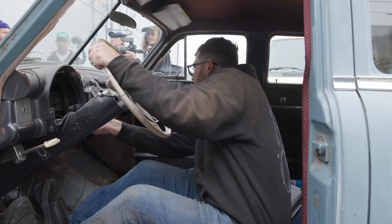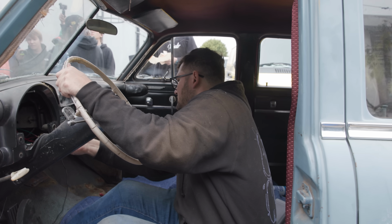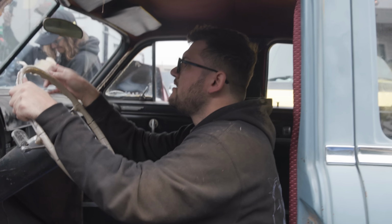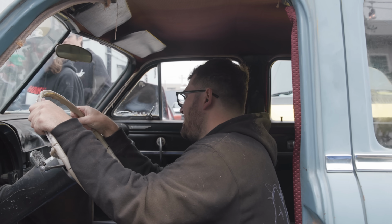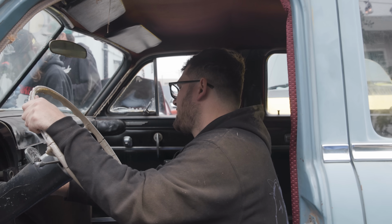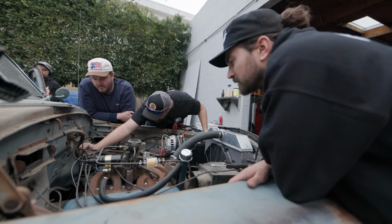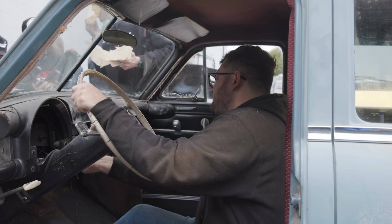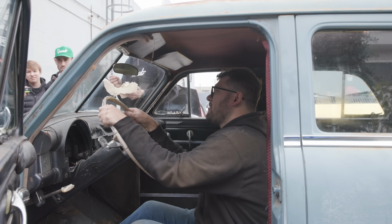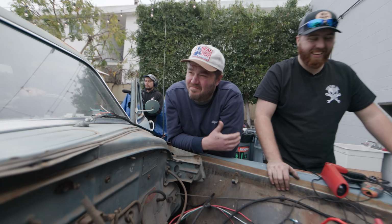All right. Do you see anything on your gauge? No. Nothing yet? No fuel flowing here either. All right, we'll give her one or two more and then we might have to prime it manually. Okay. Go ahead. I heard it bogged down like the oil pump started moving. Got it? Okay. It's up to 25 now. 25, that's good enough to start priming everything up.